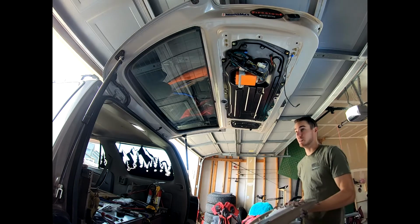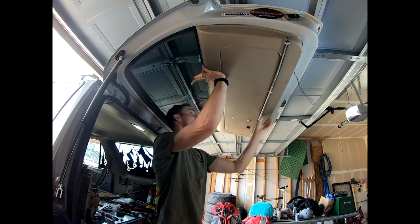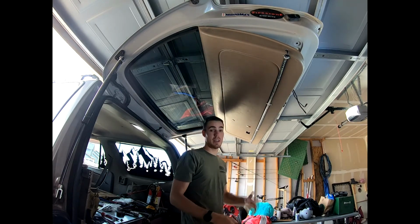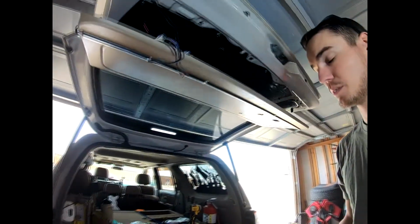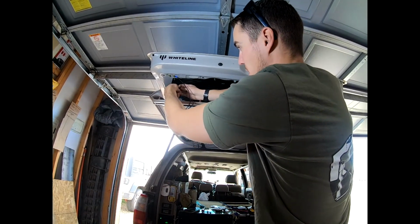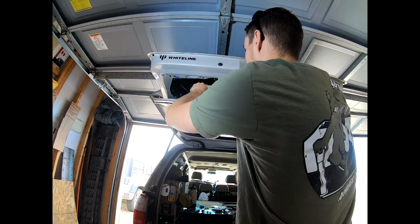Alright, so how you do this is you kind of set it up. You're trying to feed it down in. Just like that. You'll know it's good when the panel is just able to hang on its own. Alright, so now what we're going to do, we're going to come around here, we're going to make our connections. Alright, so plug in my little quick connect here, plug my ground wire in, kind of tuck that up and out of the way.